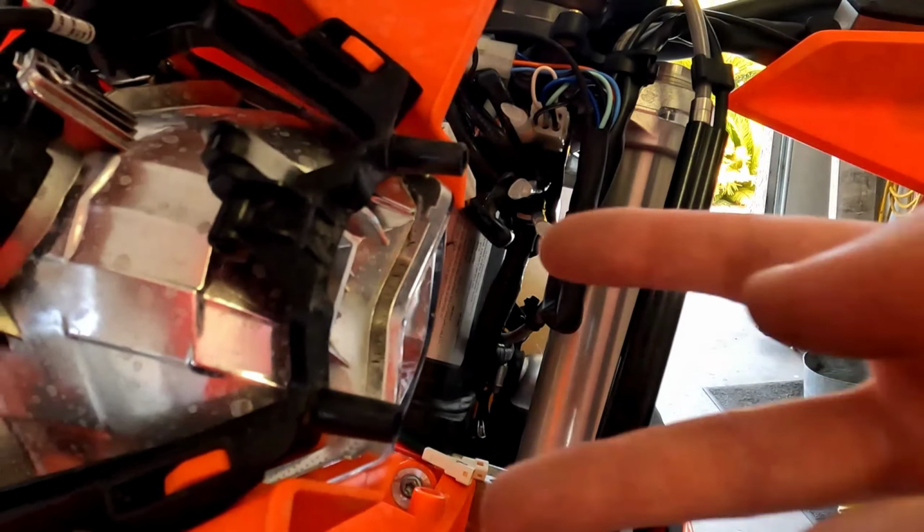All right, so then let's get this mask back up here. I'm going to go ahead and connect some of these other connectors so it quits moving on me. This is for the ignition key. Get that popped in. Go back to our left side. Turn signal. Over to that white connector. Pull that little clear insulation back. Get that snapped in there. Then you can push your insulation back in. Come to the right. You're going to do the same thing.